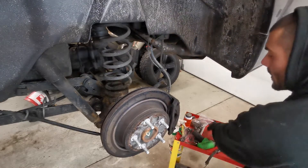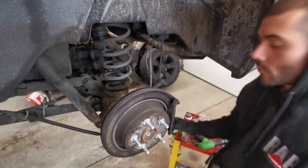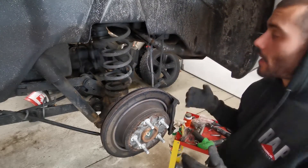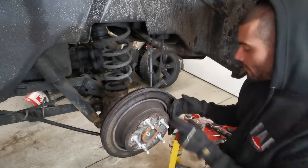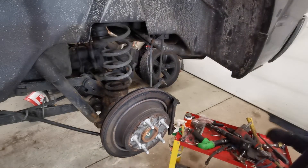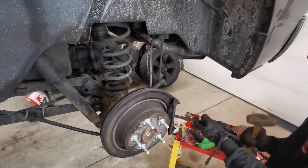Take those out and put them aside — the caliper is now free. This caliper is light, so I'd be confident just letting it hang. Sometimes heavier calipers you want to suspend and support them so they're not resting on the brake line, but this one is really light. Once you get the caliper off, we've got to hammer out our old pads from the holder.